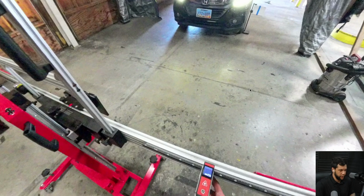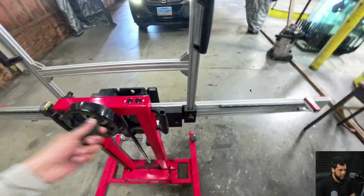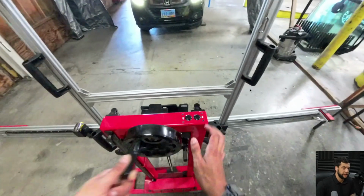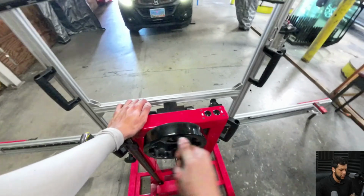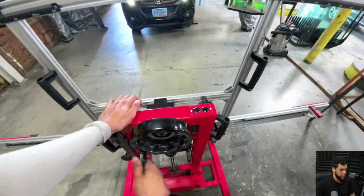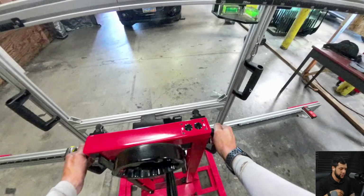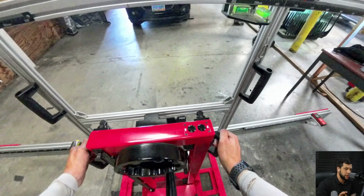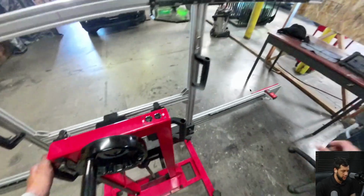Then I'm just bringing it to a place where it's gonna hit the target, and I'm gonna move it down so the laser is on the same height as the targets that I need to point into. So let me advance this part. And perfect. Right now I'm trying to measure the right distance, which is 6,110 millimeters, just as a reminder.